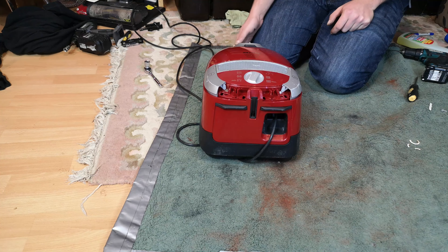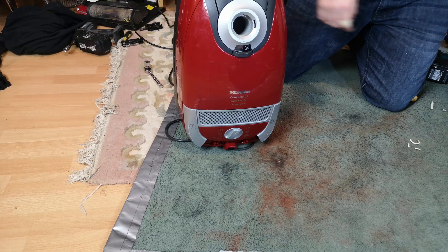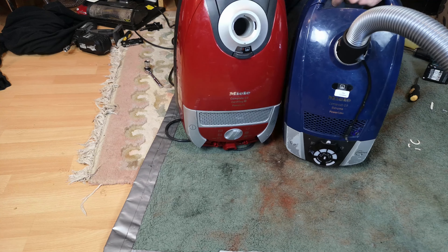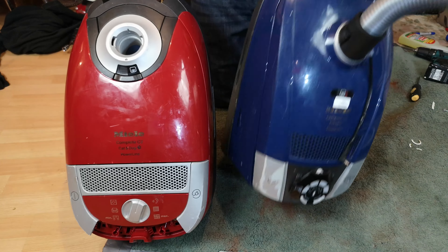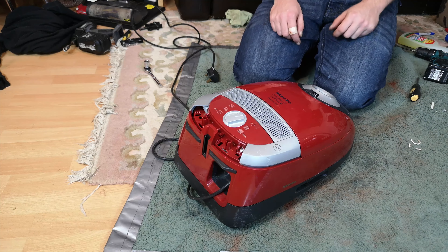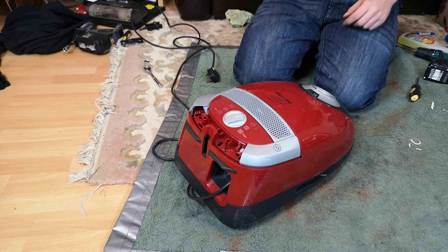This is why you never get your Miele wet - because it might look nice on the outside, but the motor is made of really flimsy material that corrodes instantly. A very nice machine trashed because it needs a specific motor which is impossible to find, because they're renowned for burning out. It's not possible to resurrect this motor. She's a cleaner, she asked if I could do anything with it - the answer is no. She'll go find another one. But what would you do in this instance - would you stick another motor in it? Despite all this, I do know which one I prefer out of my two Miele C2 Compacts. Sorry to disappoint, but thank you very much for watching - I hope you still enjoyed, and some other knackered Miele will see you soon. Bye bye.